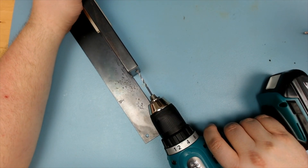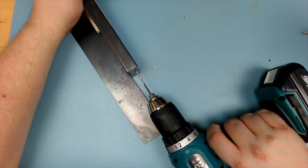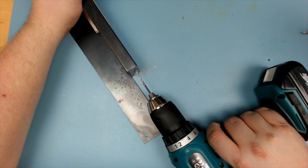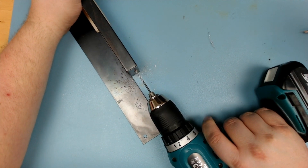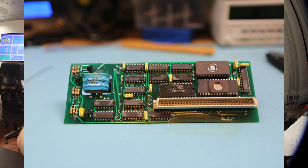I also had a little peek into the cartridge. The cartridge is riveted together — that's kind of weird. So I had to use my boring machine to extract the rivets and have a look at the circuit board. The first thing I noticed was that there was a battery inside and it had leaked. So the cartridge has acid damage all over. I guess I have a project for another video about the ABC80.